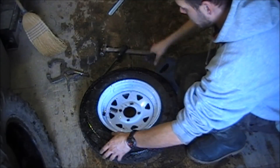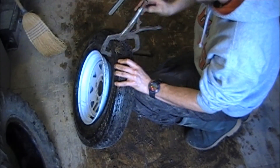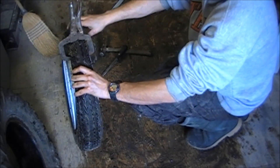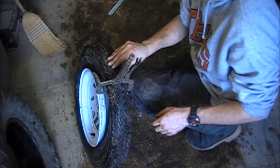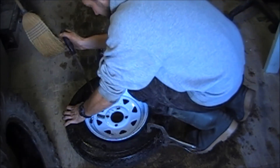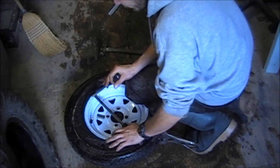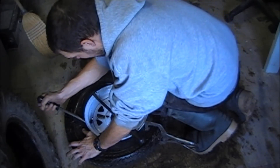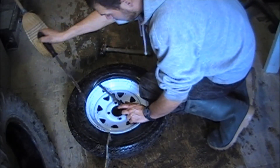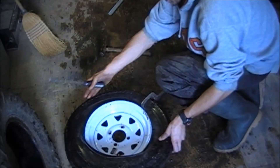I did the whole other tire and put it all back on in 15 minutes, so after a tire has weak sidewalls it just comes off so much easier. This was a complete headache — literally I have a headache because of it. Now that I've got all this done, the best thing to do is get some big vise-grip pliers, pinch it in the center. In the middle of the rim it's a lot more shallow, so when you go to pull the tire off this allows it to go into that groove a lot easier. Get it started on one side, pull it up over, and just keep working your way around — don't try to take too much at a time or it won't work so well.